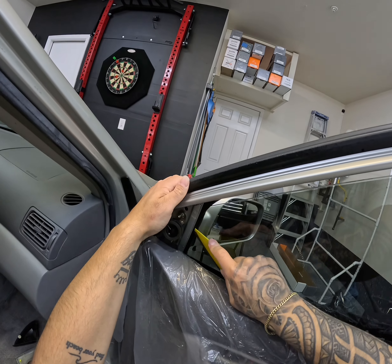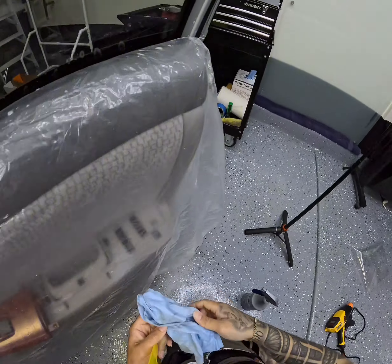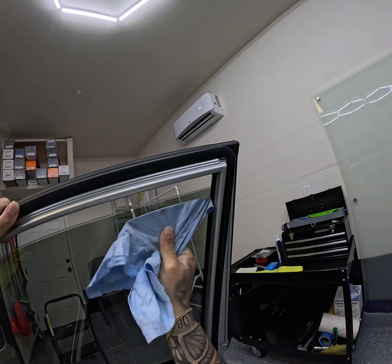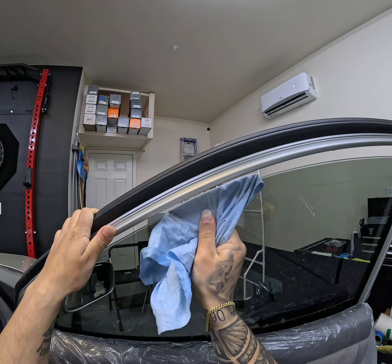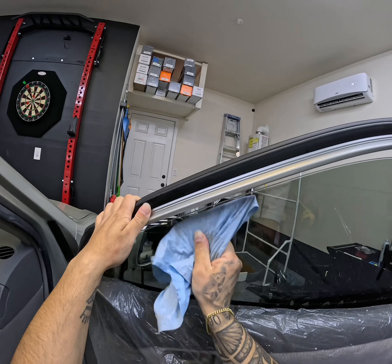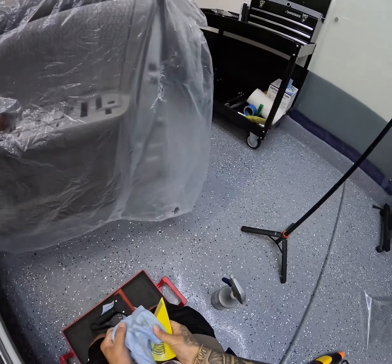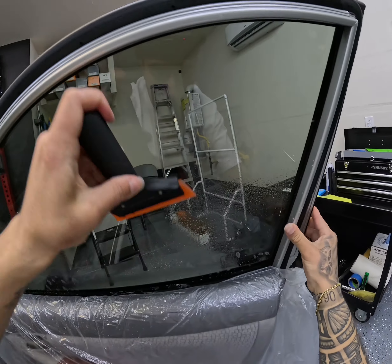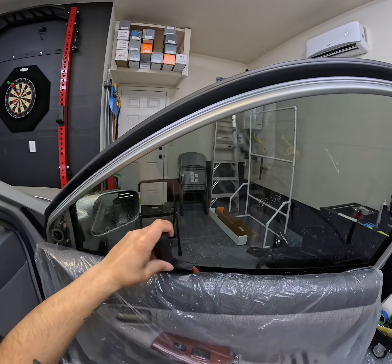To get the water out from the film inside the rubbers, I like to use my contour with slip tape on it and squeegee at an angle. For the top edge, I wrap my contour in a lint-free towel and push out the water right there at the top edge so the film doesn't peel when I put the window up or back down during installation. The lint-free towel is so I don't scratch the film with my tool. Once you're done with the top, roll your window up and do the same thing to the bottom.